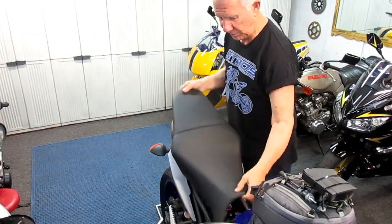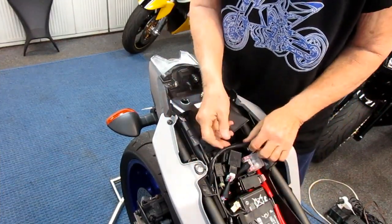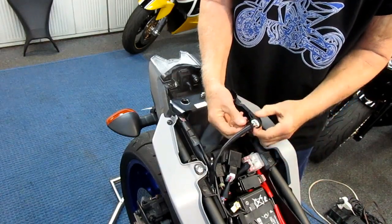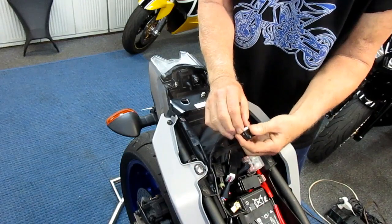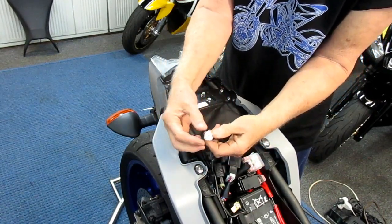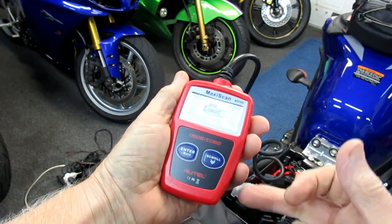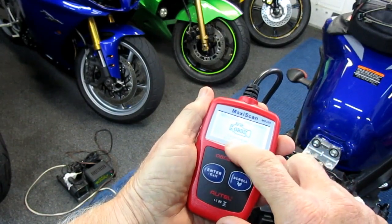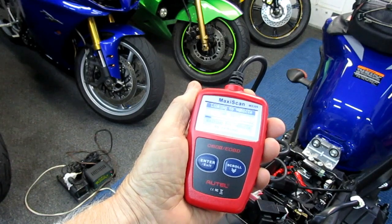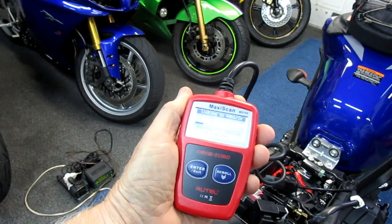We're removing the seat on an MT-09. The key is under the seat. Take the seat off, and that exposes where your connection is. I have heard people say that when they took delivery of their motorcycle, the connector was not in the space it should be — it was tucked under the side cover. When I took delivery of this bike, it was right where it should be as per the manual. There's a little rubber cover that protects it — you want to take that off and save it. That is your onboard diagnostic connector. With the meter connected, you can immediately see you don't need to have the bike running to do this — it's already talking to the motorcycle.